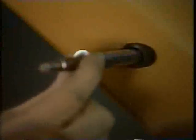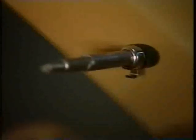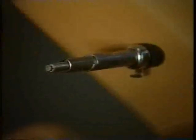Back inside the car, assemble the inside bracket. Install the rubber grommet with the angle toward the trim, then the wire clip, then the collar. Check again to be sure there is 1 inch between the chrome tube and the middle tube.